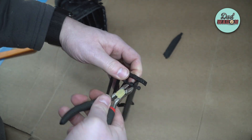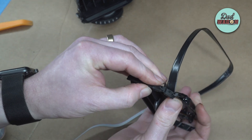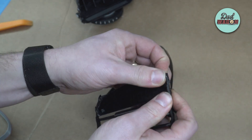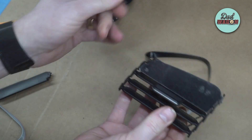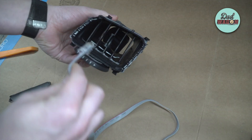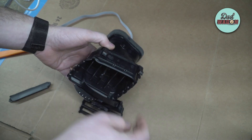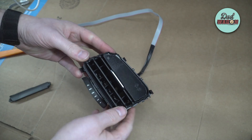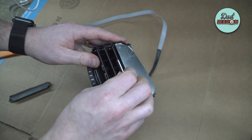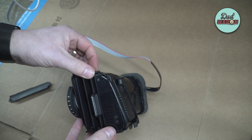There are six connection points overall that hold the louvers in place. Now that you have them removed, you can get the P3 digital display in place. I like to start by putting the smaller side in first, getting those pins into the vent frame, then working on the far larger side by gently pulling back on the frame to set those pins. Grab the cable that connects the display to the control box and feed it through the channel furthest to the left of the vent. Once the cable is pulled all the way through, start to get the frame in place — make sure the louver control bar is placed over the center of that channel so it's actually controlling the side-to-side direction of the vent.